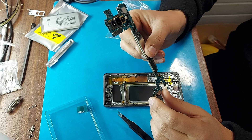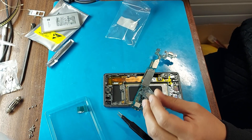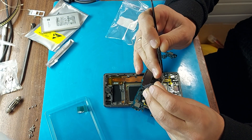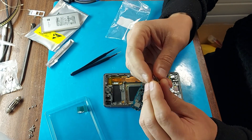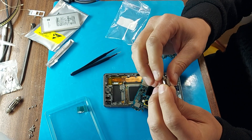With a Type-C connector, it turned out to be much more complicated than with USB connectors, because here you can't reach with a soldering iron and solder the legs since the case is closed. Fitting the connector is only possible using a hot air gun. The problem is not to melt the plastic that is inside the connector and at the same time solder the legs to the board.